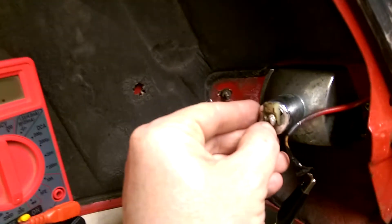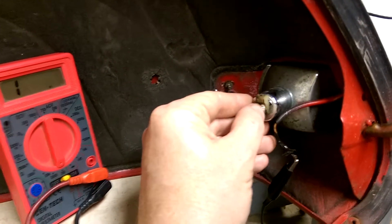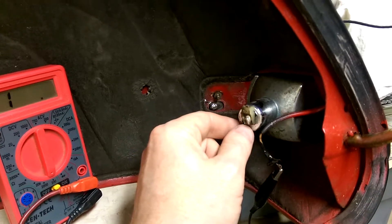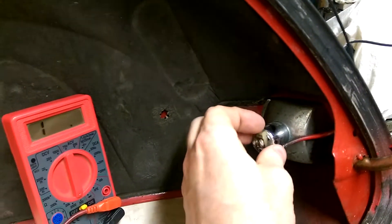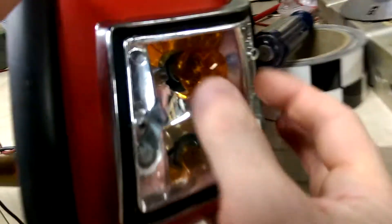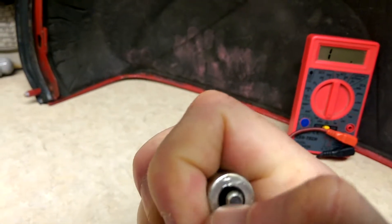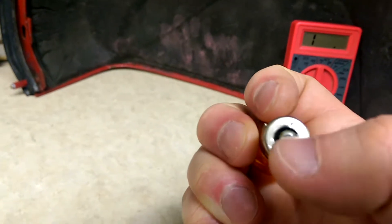The center pin where it's been soldered gets nasty in here and doesn't want to make contact. If you have access to a soldering iron, you can clean that up and solder it in place — that solves the problem. Or if you don't, take a little punch and hammer and gently tap it down until it makes good electrical contact. Pop that bulb out — you can see down inside where the center pin needs to make contact. If there's dirt on the bulb it's not making contact — rough that up a bit, and maybe add a little dielectric grease on the outside and inside to wick away moisture from the electrical connection.